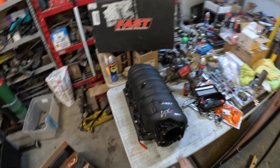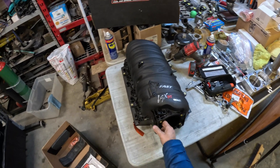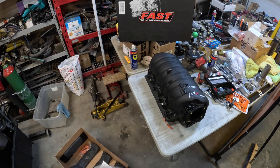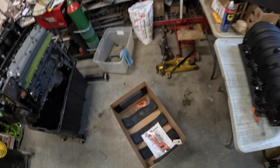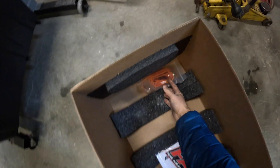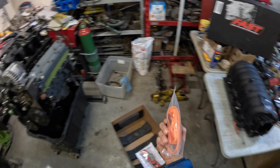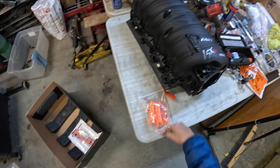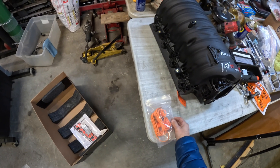So that's our LSX-RT 102 for a 102mm throttle body — that'll be nice. I got one inside. I've got BTR fuel rails because I did buy the BTR intake first; of course it didn't fit. The good thing about this intake is they give you all the gaskets too — you got your big O-ring for the throttle body and all the small ones for the ports.